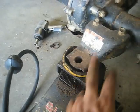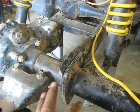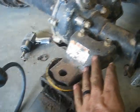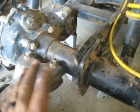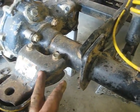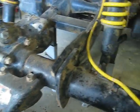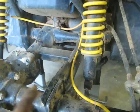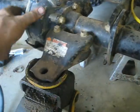Something I didn't mention earlier - you do want to stick a jack under here. Make sure you have jack stands under the frame, because once you take these shocks loose the swing arm will fall down. If you're trying to support it with the frame, the swing arm will fly up and you don't want that to happen. Let the jack stands hold the frame up.